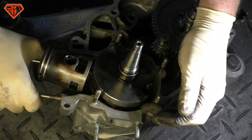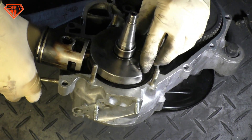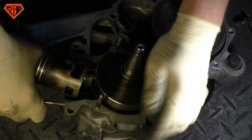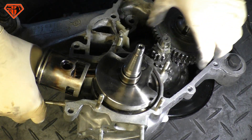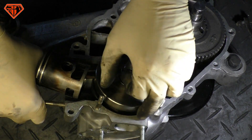What I checked before I decided to use this engine case is dummy bearings in the crank, and if we do have the 0.05 millimeter rotary valve tolerance provided. You then close the engine and measure it here with the gauge - yes, 0.05 is provided, so this rotary valve will work fine.